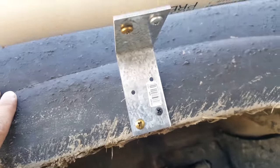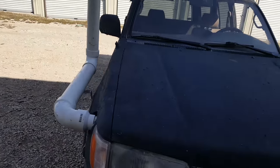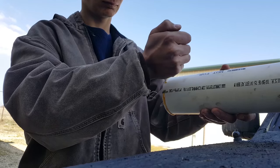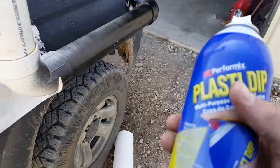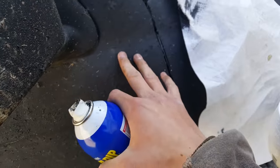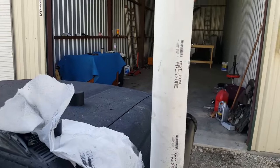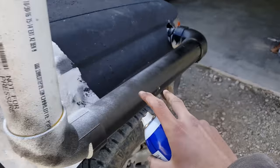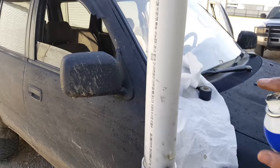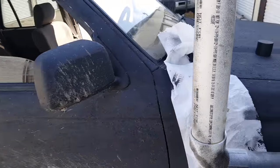I made a little bracket to go from the fender to the pipe. That could use some glue; I'll probably work on that. I got it all glued together and I'm just going to Plasti-dip it — just black Plasti-dip. I'm not too worried about overspray because this paint is already black and it's more like bed liner anyway. You want to do layers of Plasti-dip, so I got the first crude layer down on one end and I'll go back and forth, waiting a couple minutes between each coat.